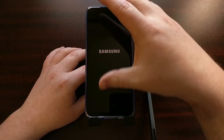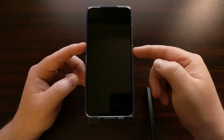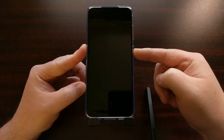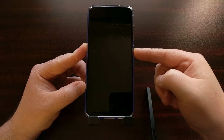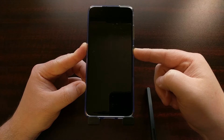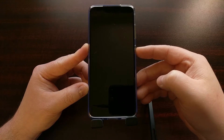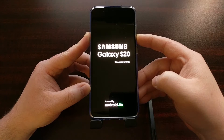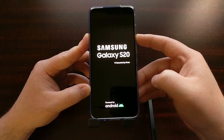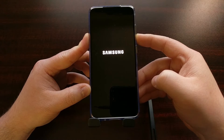So we're just going to power off the device and wait until it shuts off. Then we press and hold the power button to turn it on. As soon as we see the device starting to boot back up, we're going to immediately let go of the power button and then press and hold the volume down button. The result will be the same because we're just holding the volume down button while the device is booting up.